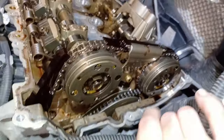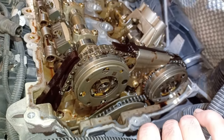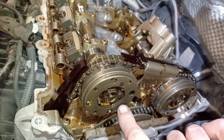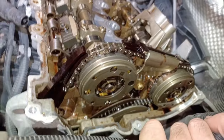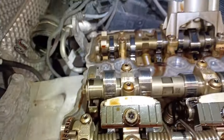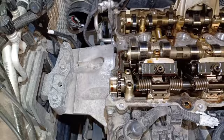And coming around here, it's a very nice, simple setup. It's a little bit tight getting the back, but either way, it's not too bad. Once it's locked up at the top and we've locked up the crankshaft, the engine's safe. And then we can start pulling these off. And these are your bolts and also your actuators for your VANOS system, which have probably failed. And what you have to be careful of on the old B engines is these lifting fingers for the valvetronic. These fingers used to fall off all the time, off the ledge down there, especially with taxis when they're idling all day long. And there's the valvetronic actuator motor, much more robust than the older ones.